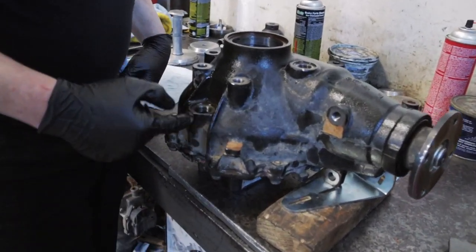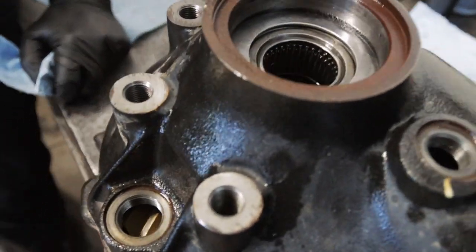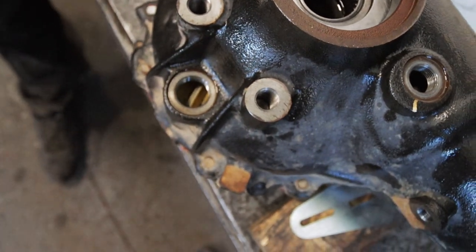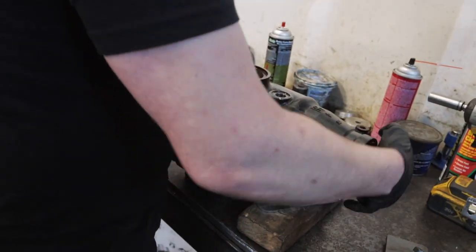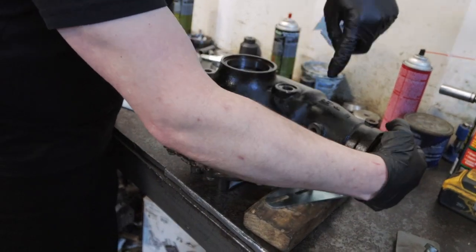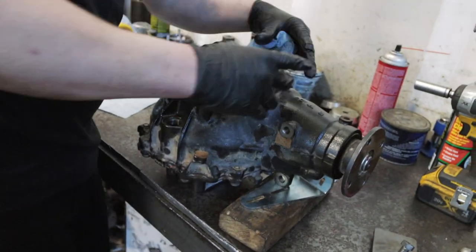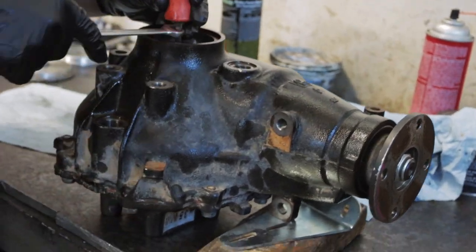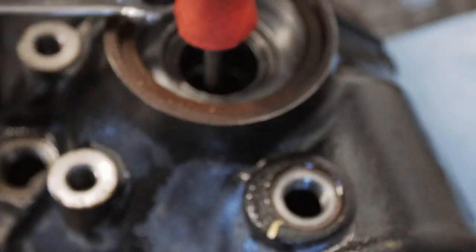Since I can't really see what's inside here, I center-line up my paint with the cross pin in the center of the diff. So now wherever the cross pin is, I know that when that paint disappears, my paint mark is right there and my pinion gear is right there. You can rotate it and rotate it, and then I'll know where I'm able to get my measurement. I put this in between the side gear and there's a place to put a wrench right there.